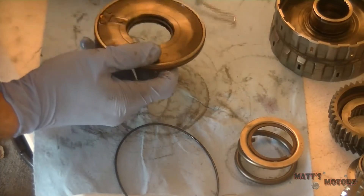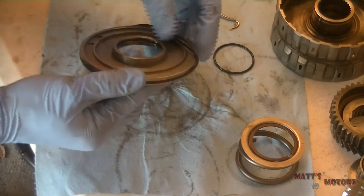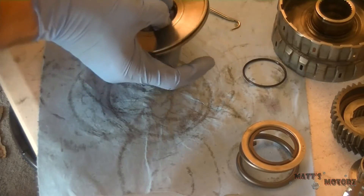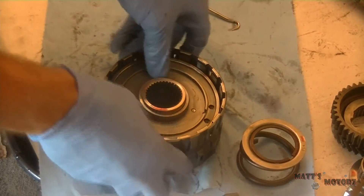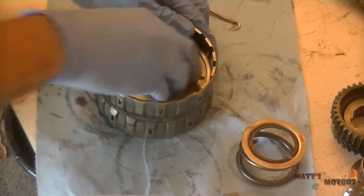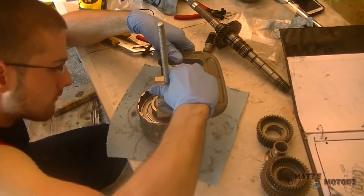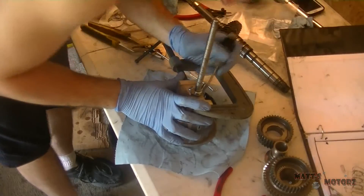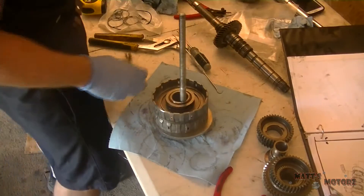Replace the O-rings. I always clean off everything before I put the new O-rings on, and before I put everything together just make sure you clean things really well. It's a really good habit because there's a bunch of friction material left over from use. We've got these two seals. Lube it up again — this time push it in and twist it a little bit until it gets down, then press gently on both sides like before to make it go down evenly. Press down and turn to make sure it's seated properly. Compress the spring assembly again, put the snap ring on. Always make sure your snap ring is fully seated — you don't want it flying off during operation.